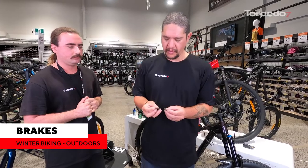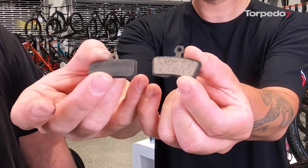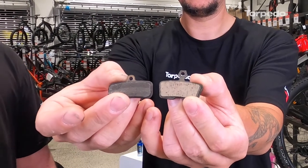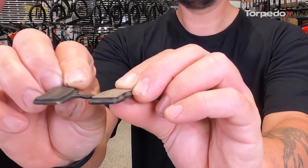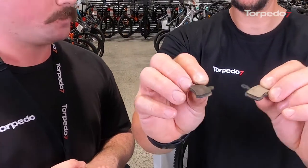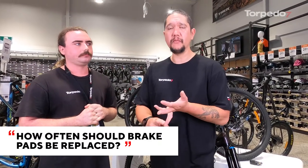Really look at your brakes — make sure brake pads aren't becoming contaminated from all the grime on the road and that they're not too thin. You can see the clear difference: the used, contaminated, worn brake pad has all the black oil, grit, and dirt on it, whereas a brand new one is nice and clean. If you turn it on the side you can see the wear. If you don't have good brakes in winter, when commuting or going downhill, you need to stop — things are more slippery. It takes longer to stop in the wet. Once they get down to minimum wear or become contaminated with washing solution, brake fluid, or dirt and mud, and they're starting to squeal, bring them in. Sometimes we can resurface the pad, but sometimes they just need to be changed.